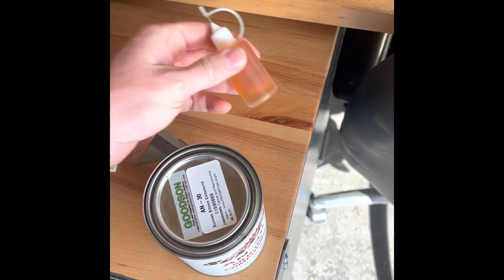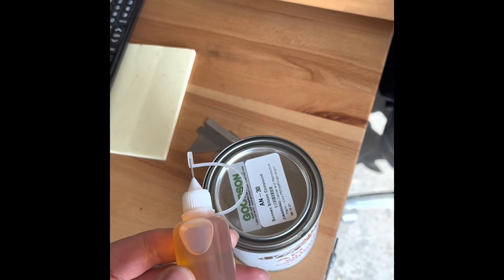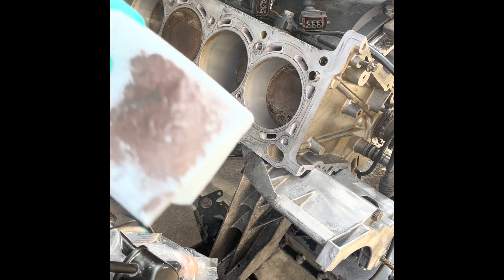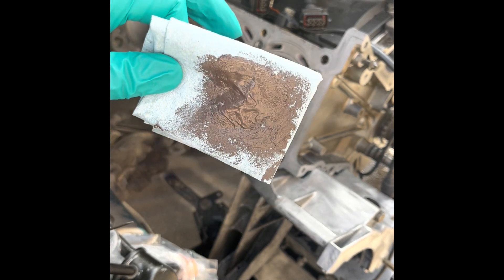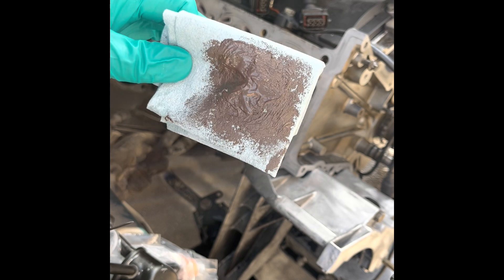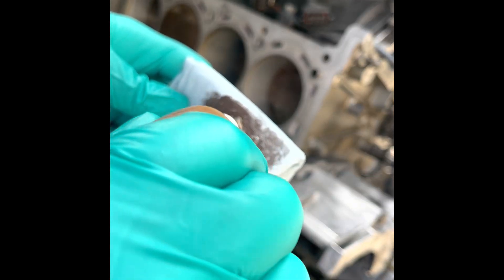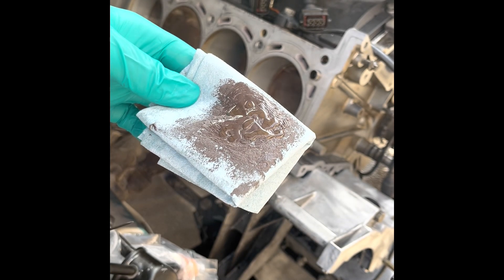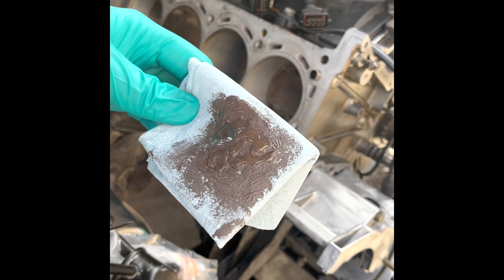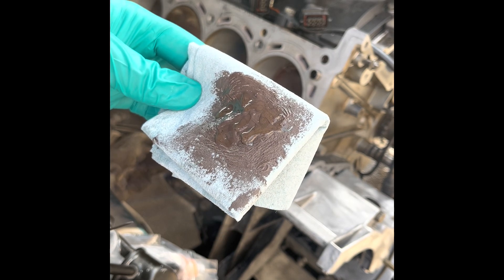In this case it's going to use a ton of lubrication. I've got a little bottle of oil here ready. I've got a little bit of the A 30 here just on a clean blue shop rag, and in line with the actual honing instructions I'm adding quite a bit of oil to keep everything nicely lubricated. I'm just going to massage it into the cylinder wall, making sure you've got full coverage.